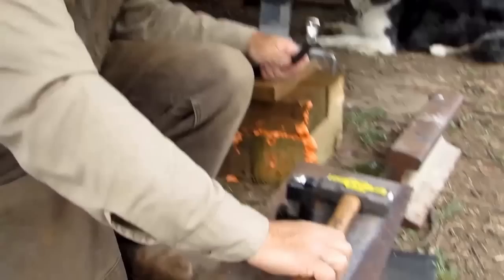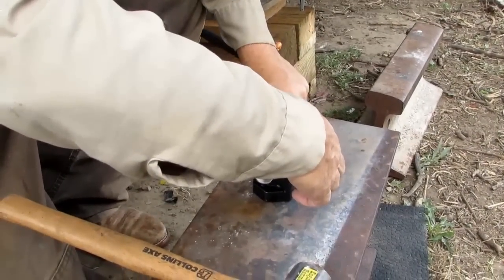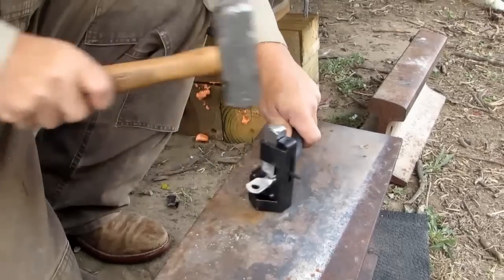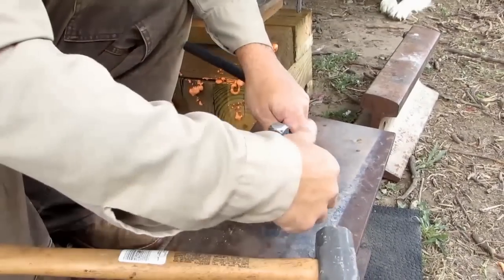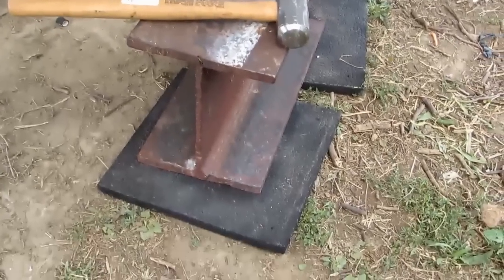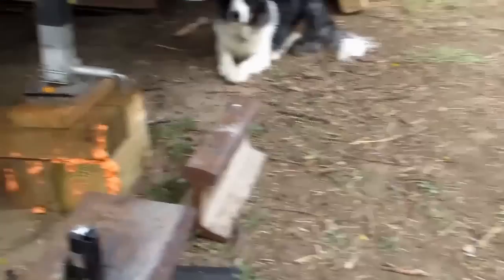We're making some more lead. This one's going to go from your fuse, from your battery bank one to the battery switch, so we're just making up another wire. He switched to the i-beam from the rail.